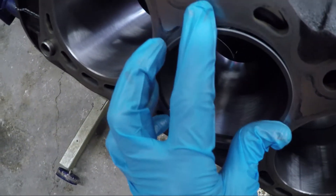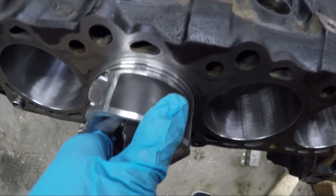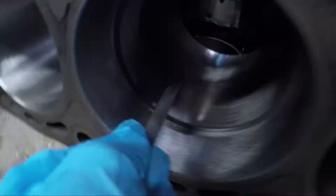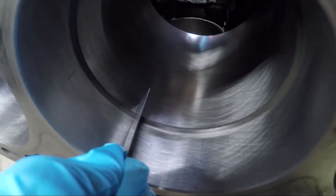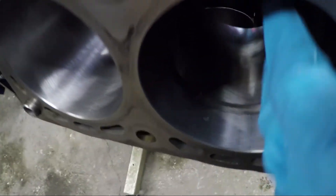Same thing — I'm going to go ahead and get that ring pushed in there. Got it started, got this piston again, and push it in there. The reason I have the engine block turned sideways is because it's a lot easier for me to push the piston in and also access the connecting rod. There's the gap — 0.38 barely fits, so just outside of tolerance.